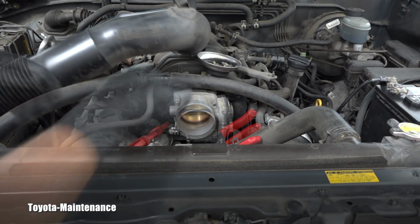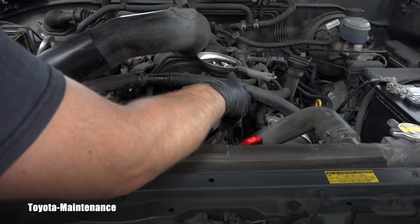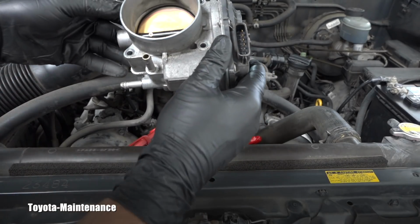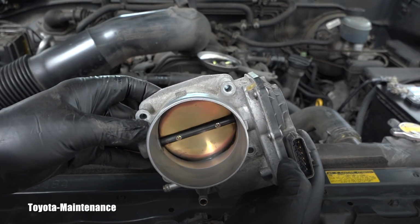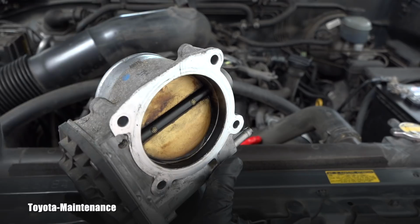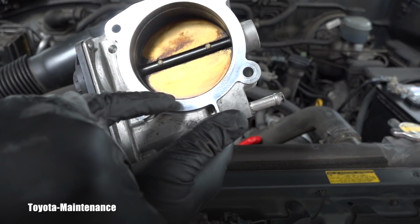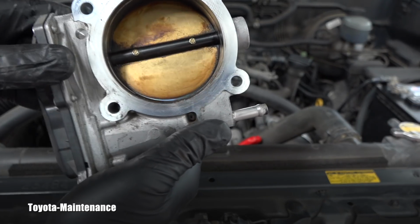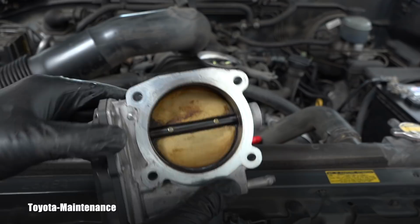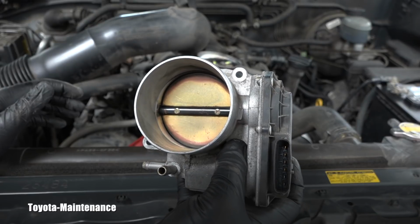That's awesome. So the last bolt is at the very end, and you will be able to see the throttle body itself. So here we go. As we said, this one actually surprises me. This is definitely one of the cleaner ones. Why am I saying that? Because this layer is very thin. Do you see between that butterfly valve, do you see the light there? On both sides I do. And that means it was not fully plugged. And this one was actually getting some good maintenance.